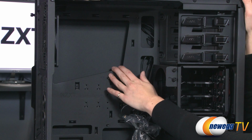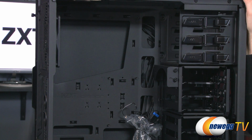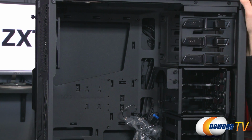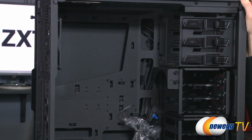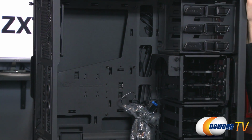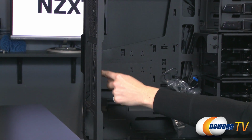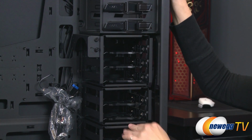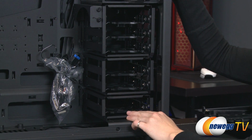Moving on now to the motherboard mounting point. We have support on here for ATX, micro ATX, mini ITX, and eATX. You have a CPU cooler clearance additionally of 183mm, and also you have GPU clearances here of up to 282mm with the pivot fan, and then 310mm with the cage and 444mm without the cage. Moving on now, we have 8 expansion slots, 3 5¼ inch drives, and then we have 6 drives here for either 6 3.5-inch hard disks or 6 2.5-inch solid state drives.